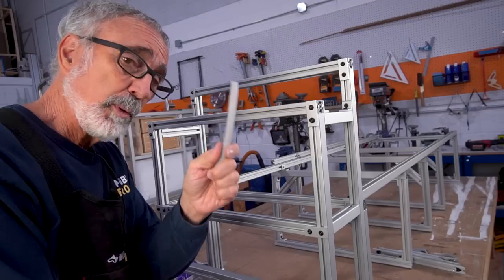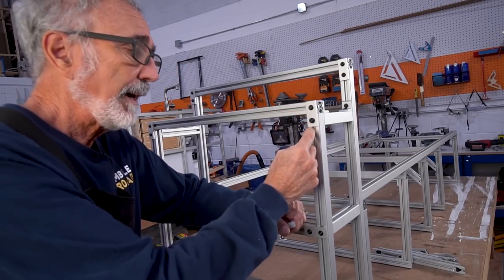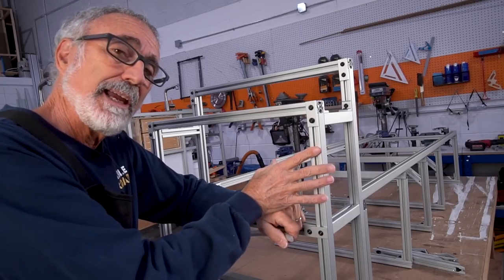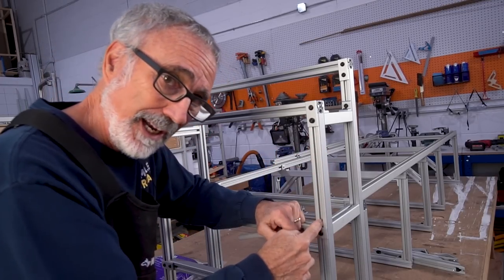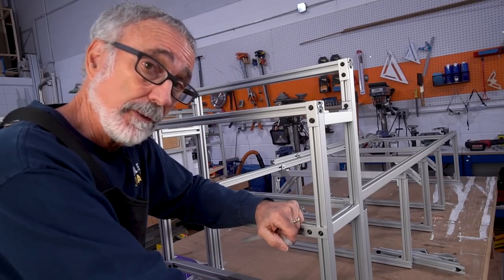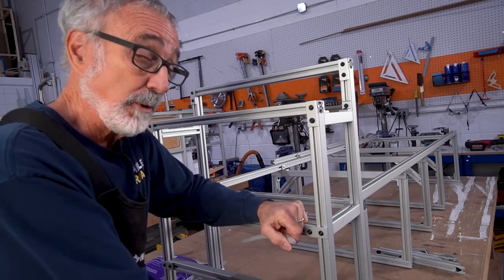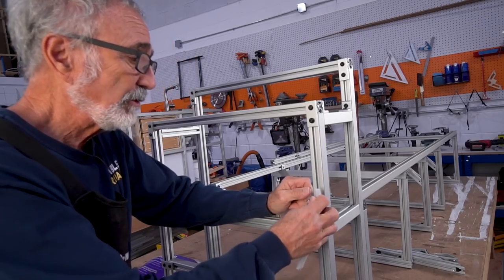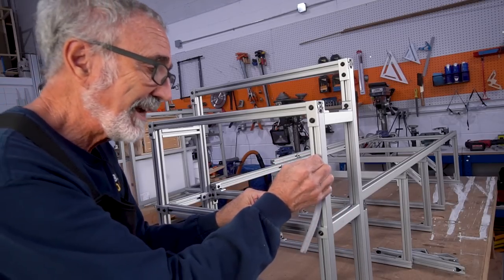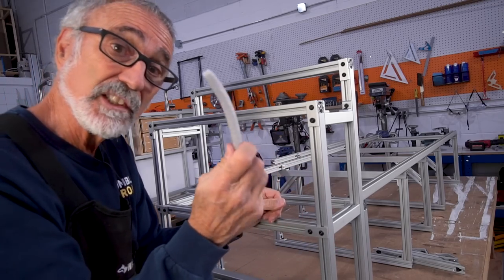There's another point where this is very important. I've had this happen — I'm putting a roll-in T-nut into a job that's already been assembled and I need to add a piece. If that T-nut were to slide down, it would go to a point where I wouldn't be able to retrieve it. I'd only have one shot, then it would rattle while you're driving. So you get some rope caulk, put that in, then put your roll-in T-nut and it sets exactly where you want it. This stuff is genius.